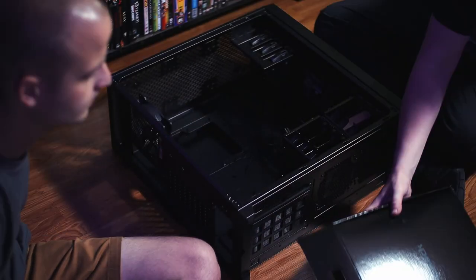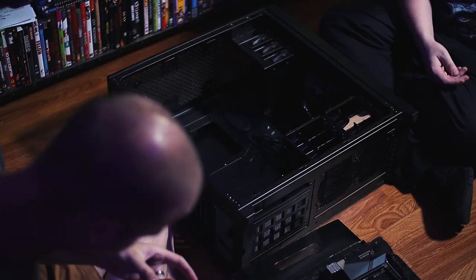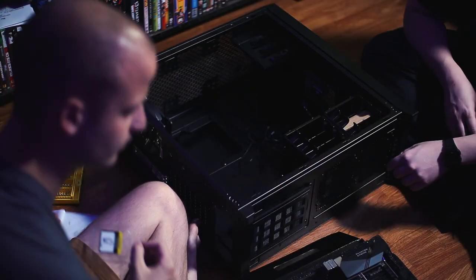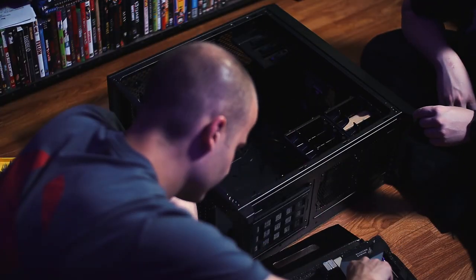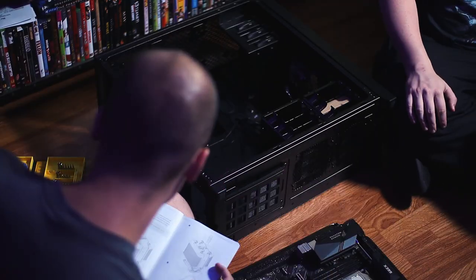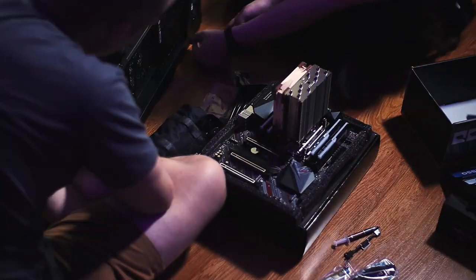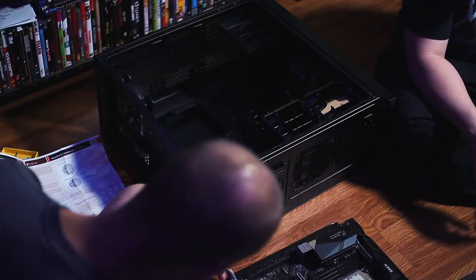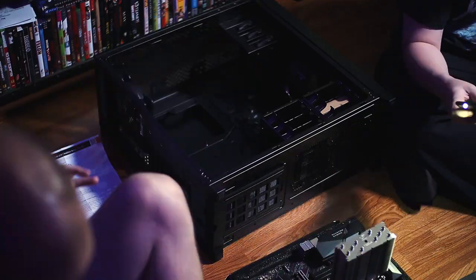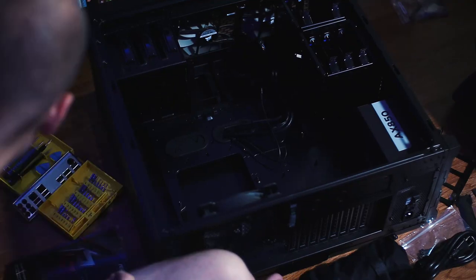What you're watching now is some time-lapse of the building process. Nathan Bowler was kind enough to come by my studio to help assemble all the parts. There are some things you want to keep in mind when building a PC. The most important is installing the CPU into the motherboard — this is often the scariest part if you've never done it before, so make sure to follow the instructions for the proper method. When taking the motherboard out of the box it's good to set it on the box it came with rather than on a hard floor. Apply enough thermal paste to cover all of the dies of your CPU and tighten it enough to get a solid connection so it doesn't overheat.